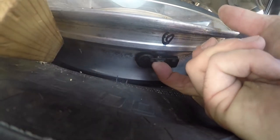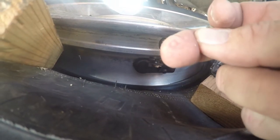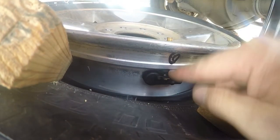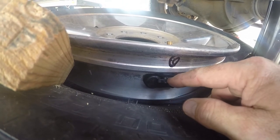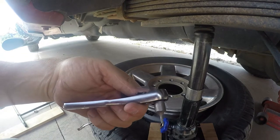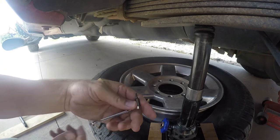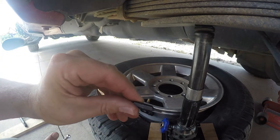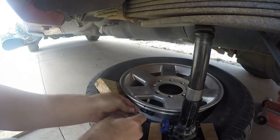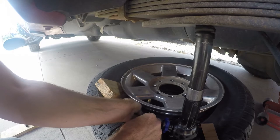It looks like a Torx. We can try to pull that out, and I think I'm going to end up cutting this valve stem to get it out because this is not the unscrew type. Even as low profile as this is, that doesn't fit in there. I can try to jam this down further, but I think I can get away with just using this. This is a T10 — that's what feels like it fits — and I'm going to use a quarter-inch wrench underneath it. Hopefully this will work out okay. It'll be slow, but...